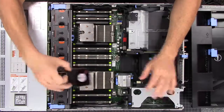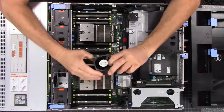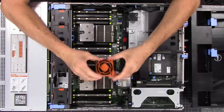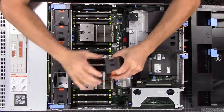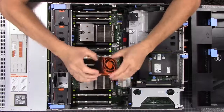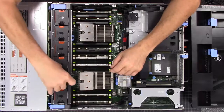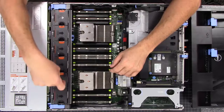The fans are modular, which is really cool. This goes back to why you'd want to buy a used server — TechSupplyDirect cleans it up really nice for you. This is another advantage of a server that's plentiful in the market: buy a spare fan before it goes bad. Fans do occasionally fail — it's rare, but not completely unheard of, depending on the dust levels in your environment. You can find these cheap even on eBay, keep a spare on top of the server, and if you ever get a fan alert, you don't have to wait a couple days for shipping.